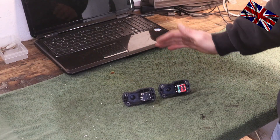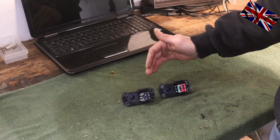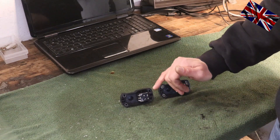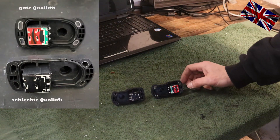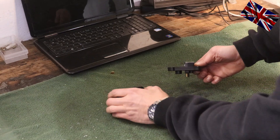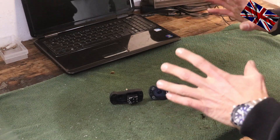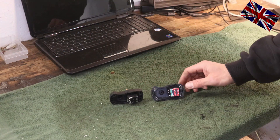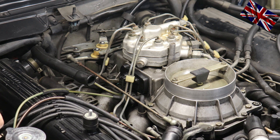Here we go — two potentiometers in a price range of 20 euros to 200 euros. The cheap one: low quality, you can tell right away — the touching tips of the brushes are tiny, cowboy soldering. See the enlarged picture on the left. This one here is a Bosch — see where the brushes are touching. High quality, with high-conduction brass pins, compared to what are probably tin tips on the cheap one. Since this is a quite important component of the K-Jetronic, I definitely recommend the Bosch spare part to avoid trouble and rough idle in the future.